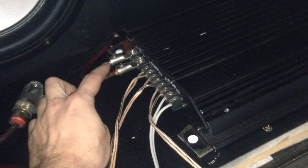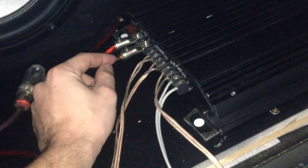Once you've got your power cable and remote cable all the way into the boot, get your fuse and put it in the boot. Your cable kit will probably come with a cable long enough to stretch the whole length of the car. Cut that cable, wire it into your fuse housing, then on the other end wire in more power cable — that becomes the power feed to your amplifier. Then connect your ground cable to the amp and secure it to somewhere on the body of the car to properly ground it.